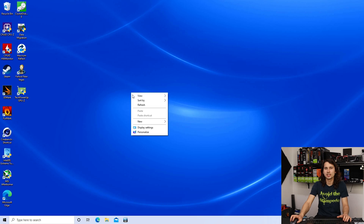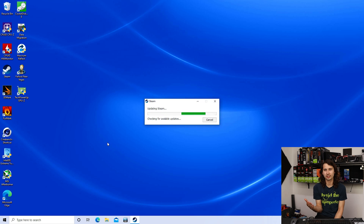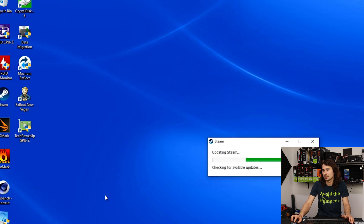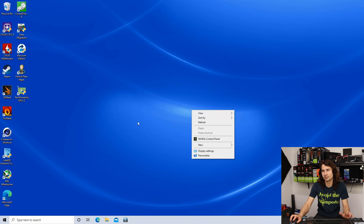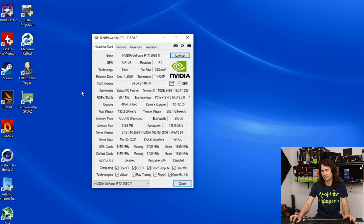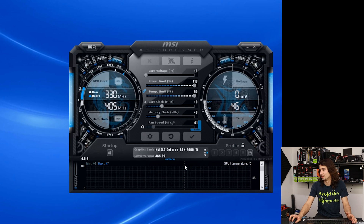It's already looking better. Now just wait until the drivers apply — the screen will flash when it happens. Before, when the drivers would apply it would give you a black screen, but now we should have Zotac power limits. Re-enable your device in Device Manager if needed; sometimes it'll give you a code 18, just restart your computer. Go ahead and open GPU-Z — it shows it as a Zotac PC Partner card. Then when you open MSI Afterburner, you have 110% power limit. Nice.